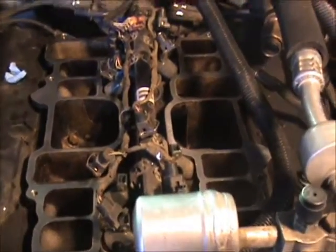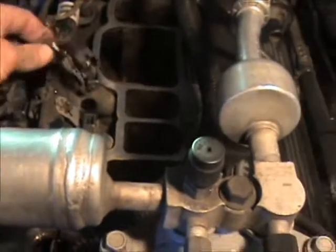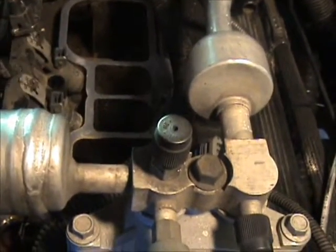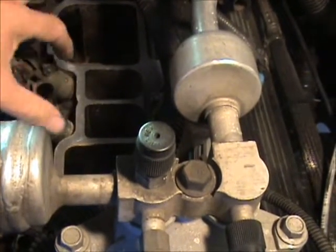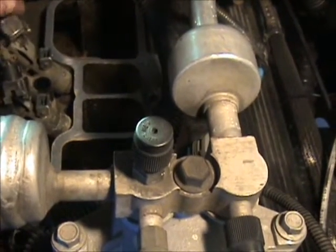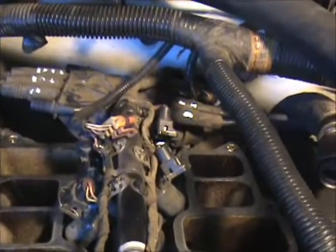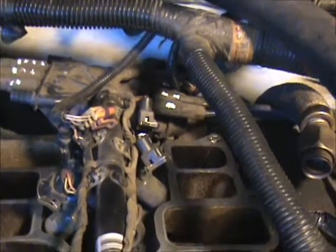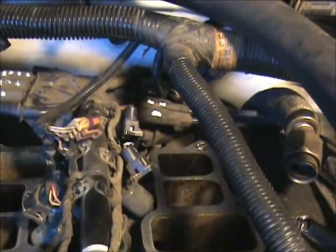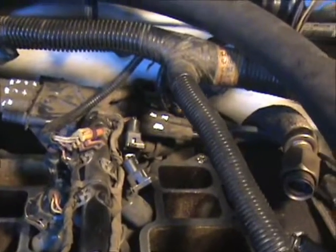I'm working on the fuel rail. I've so far disconnected each one of these, and when I disconnected them I marked them according to the number on the front — so this one has a one on it, this one has a three on it. I also did the same thing with the distributor cap: each spark plug wire got dash marks to represent its location on the cap. Now I'm going to remove that cap.